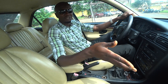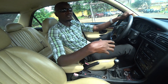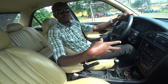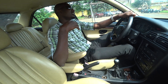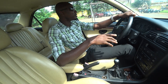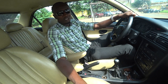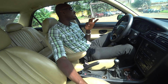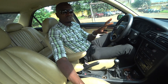It may not be all of them from 2003, but even those produced in 2003 in foreign production - most of them come with that front-reverse assembly. So you can use that gearbox because the clutch pressure plate and friction plate are similar to that of EW10J4. If you put it in, it becomes very very soft. That's if your problem is that the normal V6 pressure plate is too hard for you, or the normal EW12 with the bigger design still feels hard. Now there's an option: instead of putting back the 2003 five-speed, you can put the six-speed manual gearbox removed from a Peugeot 407.